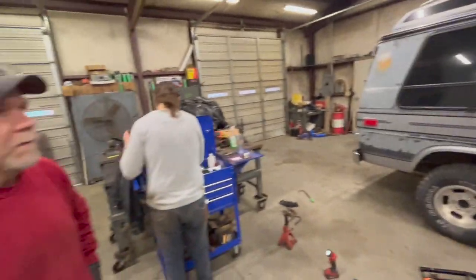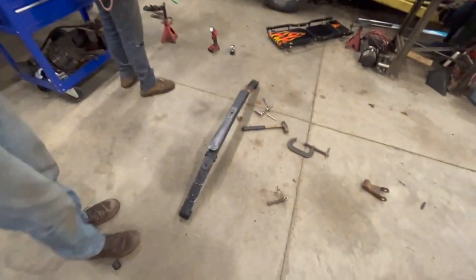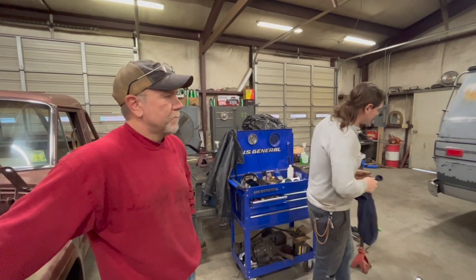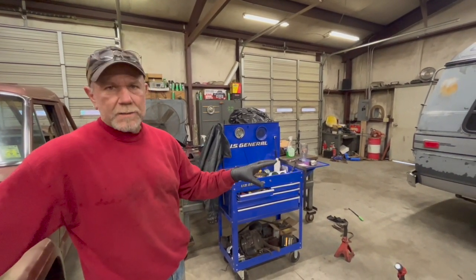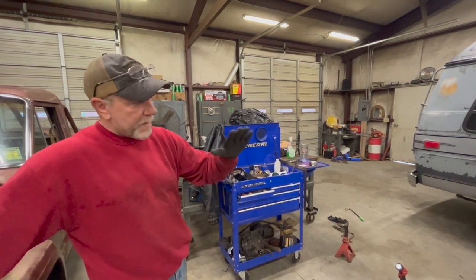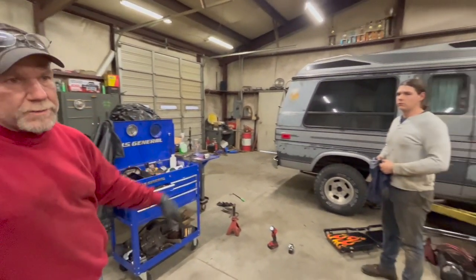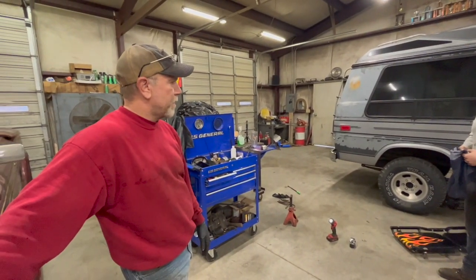She is under there. Yeah, we took that spring out, played with the other spring, got the leaves and all back together, and that one looks like it's going to be right. We've got the perches where they need to go. Everything's centered up under there just like it's supposed to be, so we're going to tack the perches in, double check the pinion angle. We're pretty close on that. We'll double check the pinion angle, tack in the perches, raise it back up. We'll burn the perches in good where they're supposed to be. Go ahead and set it back down on the ground, bolt the rear end up under it,